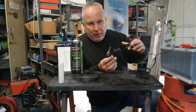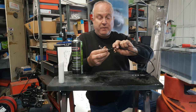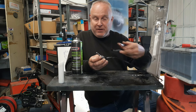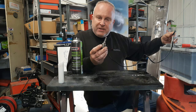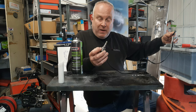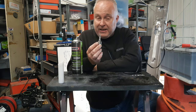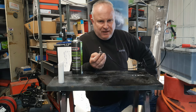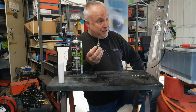A couple of top tips and points to note: when you connect up the connector, fit it in the best way around, whichever way it goes. Injectors are not polarity sensitive — plus and minus can be connected either way around. Also don't worry about holding the injector open continuously for up to about four or five seconds while you spray through it. If you hold the power on the injector for too long — after about 10 seconds — it will get too hot to hold, so you will have to let the power go, but don't worry, that will happen long before you burn out the injector itself.